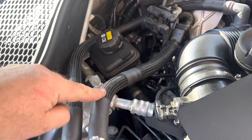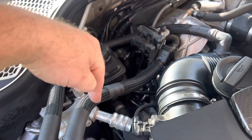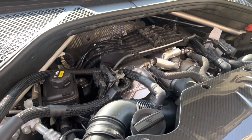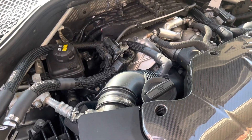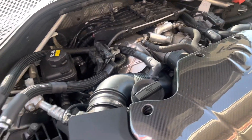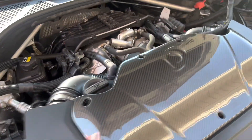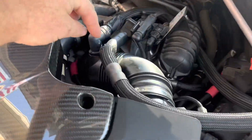This line will be out of the engine. The crankcase pressure pushes air out, it gets filtered through the can, and clean air goes back into the intake. I believe it's important to keep both the in and out lines because with turbo engines pressure can build both ways. It could push air in or pull air out depending on how much pressure or even negative pressure is in the crankcase.